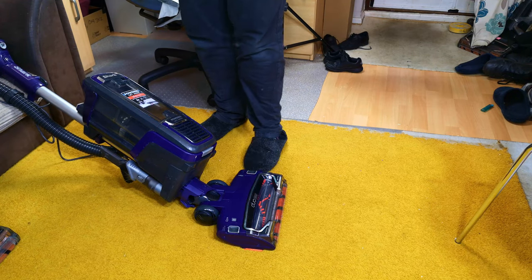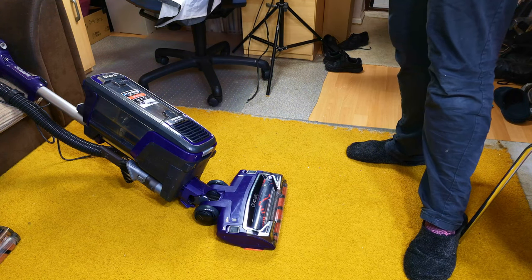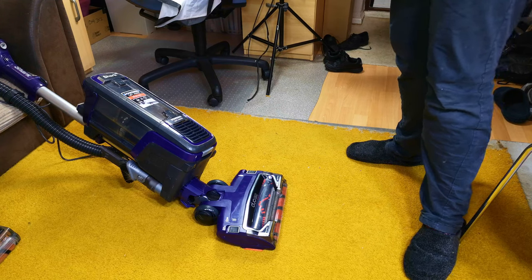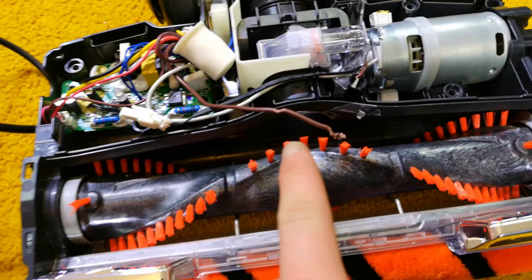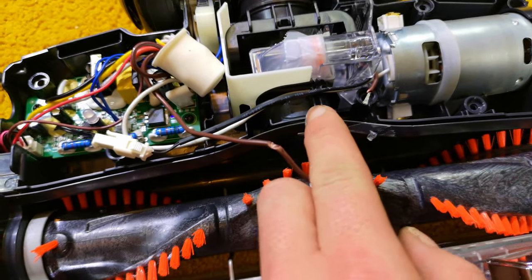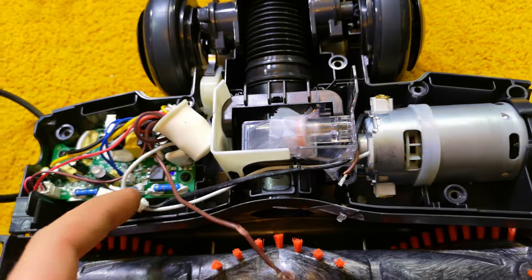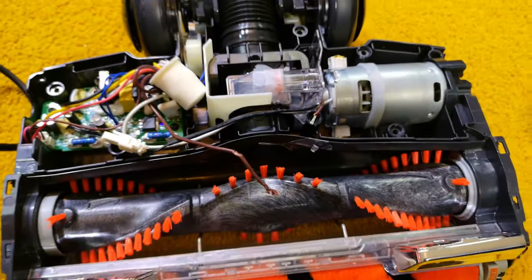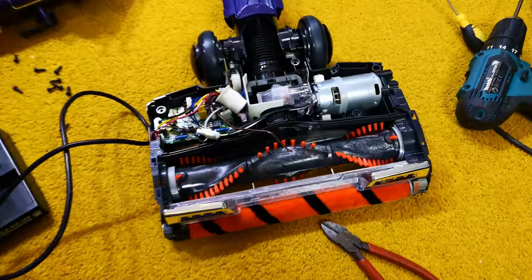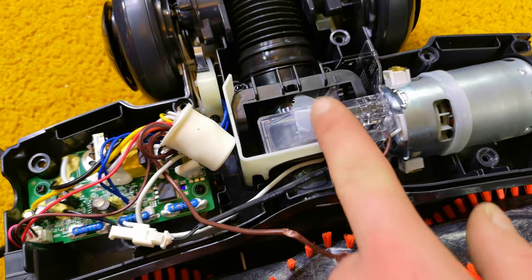Oh hello — let me troubleshoot. I'm sorry, I haven't tested this — that's why I normally test them before filming. Being honest, you must be careful when you reassemble a head. What I think has happened is I trapped the wires here because I put the motor on the other way. I think this white wire wants to be at the back because it's longer, and that's caused this trouble. I've had to strip it all down. While we're here — that's the vent in the head that I blocked up.